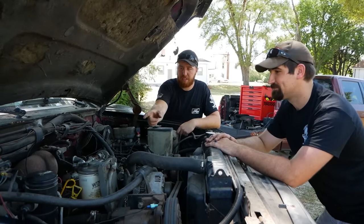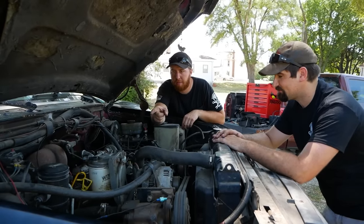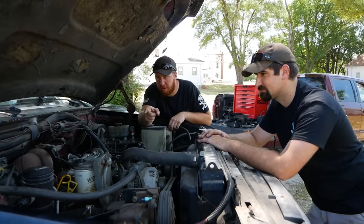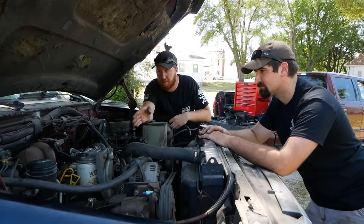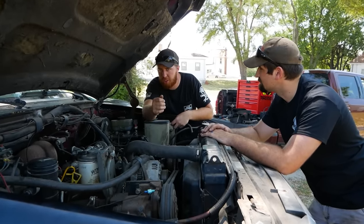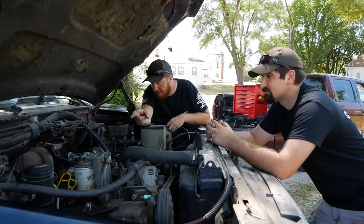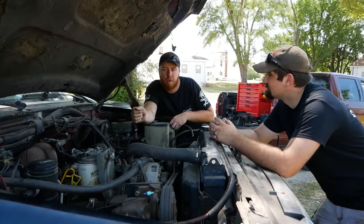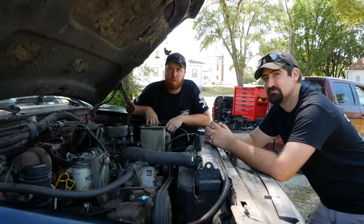In the meantime, I'm going to try to set up a better fuel system. We're going to get that filter back in play. I'm either going to feed it electrically from the front with my pump or try to get that mechanical going so we know we have the right amount of pressure. I think one of our problems as well was every time I shut that pump off between tries, it was basically losing our prime. So that has a Schrader valve that I can just reprime it every time and know that it has fuel. So those are our steps moving forward. Let's begin.